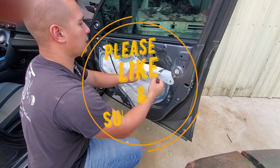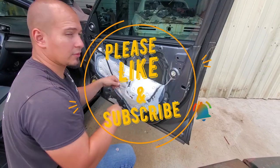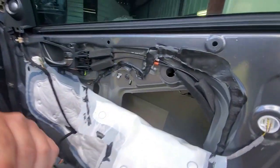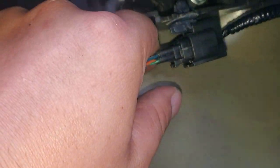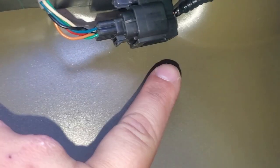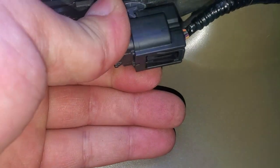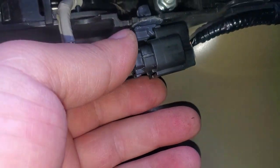Once you're here you're gonna pull down on this plastic sheeting. You have this connector — it's gonna look like you're gonna push here, but you're not. You're actually gonna push at the back, which is the one you're gonna push up on, and while you're pushing up you're gonna pull back on this one.